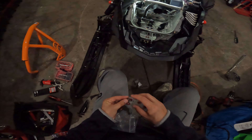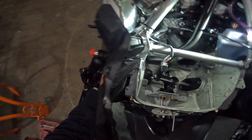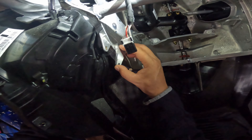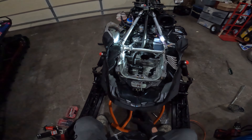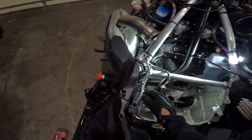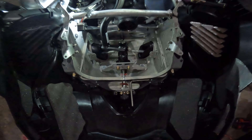Washer from the outside, and then I believe this was that side, and this should be this side. Find the hole over here — a little tight. They should mount like this. So to recap: got the hardware in on these brackets — washer from the outside, bolt, washer, nut — after the bracket goes on, just hand tight for now on both sides, because you'll want a little wiggle room as we have to slide the bumper in.